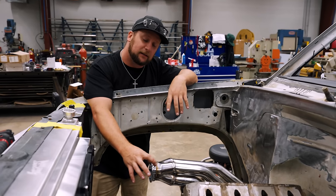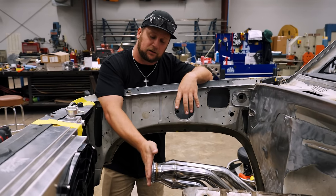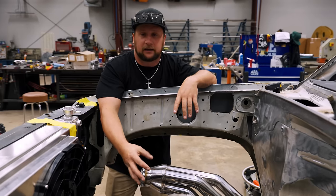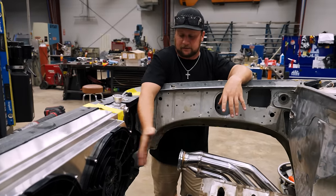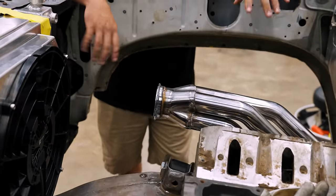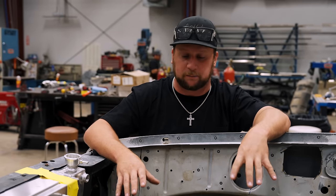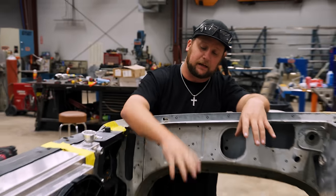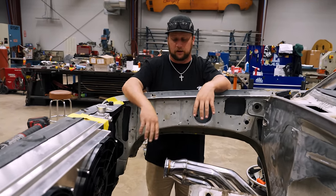So I'm going to cut back, slip a new V-band on here just a little bit further back. They're a little crooked anyway, so we're going to square them up, slide them back, do a reducer to our Hellion turbos, and you can see, just try to picture a whole intake, turbo, all kinds of stuff off the front of here. So we're gonna try to save as much space as possible, get them squared up as best as possible. So take us over the table, cut that flange off, come back over here, slide a new one on it, get it all squared up, weld it up.